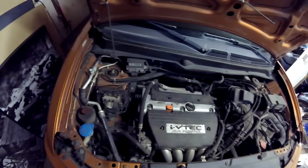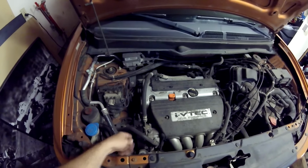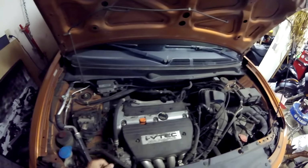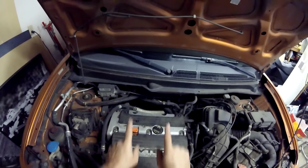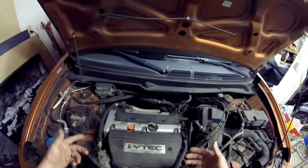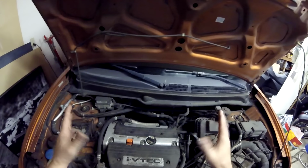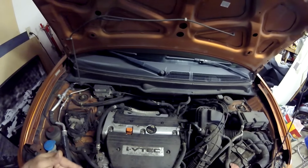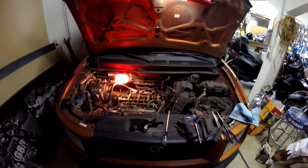And you know how they want you to do it is come through the fender well and turn the crank over, but with the plugs out, you can actually use the power steering pump and turn it. The engine is facing this way. This is intake and exhaust, and the engine rotation would be considered counterclockwise. The engine is running forward as it sits in the vehicle, but from intake to exhaust, the cams are turning this way. It's running counterclockwise, just as suspected.